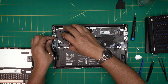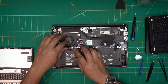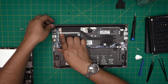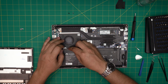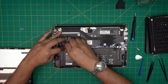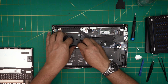Now grab the fan and run the Wi-Fi cable. It's easier to route while holding the assembly in the air. Route it halfway through and then under the heatsink. Leave a little bit of curve so the hinge opening doesn't pull the Wi-Fi cable. Route the Wi-Fi cable under this side too — you just have to zigzag it around the fan. Zigzag the speaker cable too.